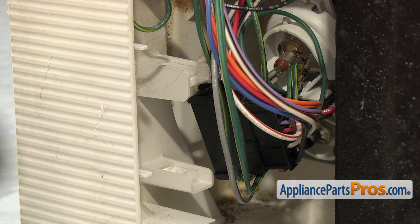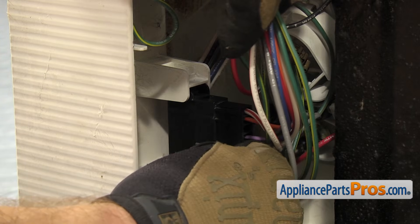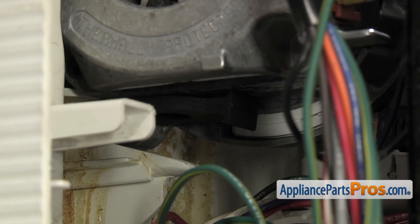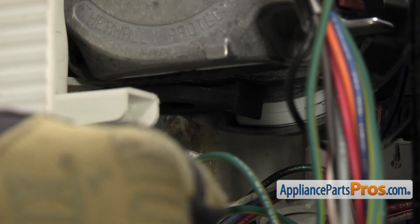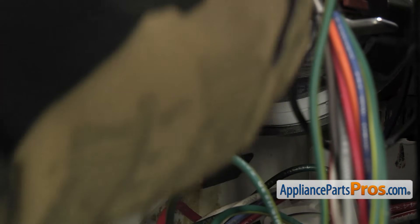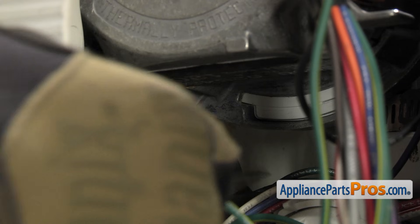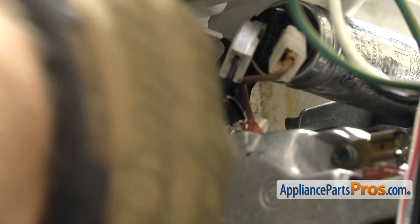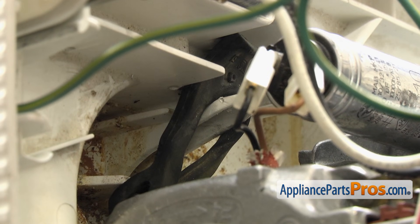Now that we have all the wires connected to the motor, we can put the wiring block back into the base — make sure all the wires are out from underneath it, then push it back in and lock it in place. Now we can put the rubber straps on that hold the motor. To put the strap back on, you have to reach in and stretch it over this little peg. If you can do it with your hands, great. If not, you can grab it with a large flathead screwdriver and stretch it out and put it over the post. Once you have the one on the back hooked up, go to the one on the front. It's a bit tight, but just reach in and stretch it with the screwdriver to get it over the post, then press it in from the top with your finger to make sure it's all the way down.